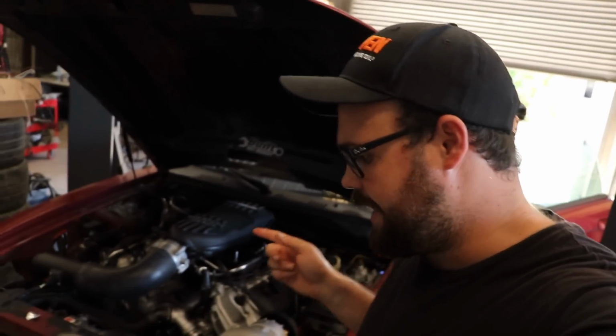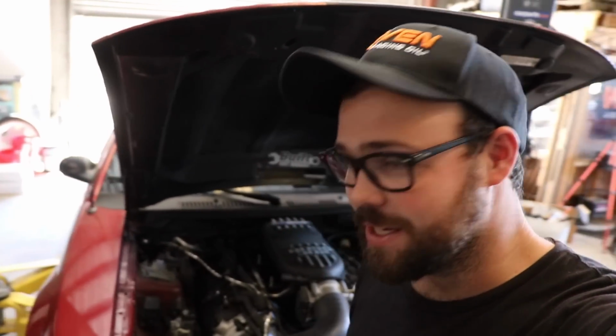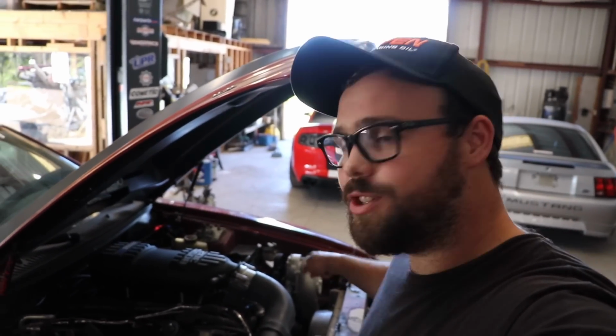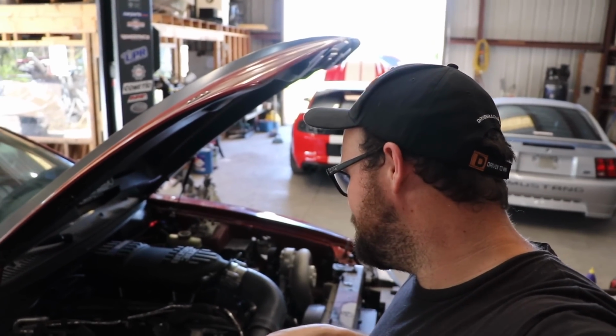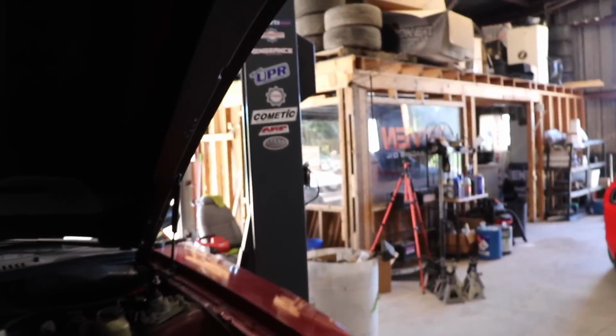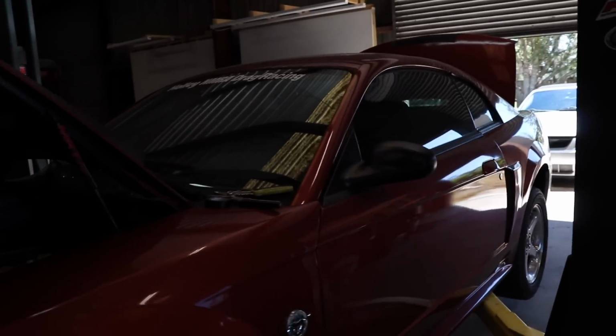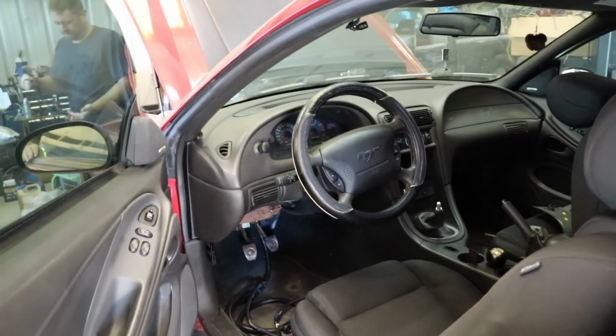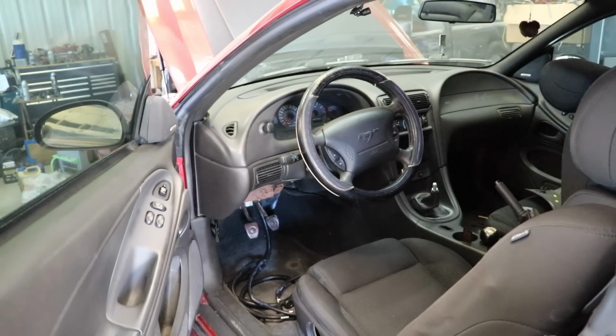We're gonna work on cleaning that up, but we're on a little bit of a time crunch. I gotta go, I got dinner plans with Ashley, but we're gonna try to start it beforehand. We think we got the fuel pump wired, we got the tach and everything wired, which isn't necessary for start. Supercharger has oil, and engine has oil, so we gotta hook up start stop, which is basically your key on signal and your start signal, which we typically tap into behind the column over here, and we'll also plug in the gas pedal as well, so we can go vroom vroom.